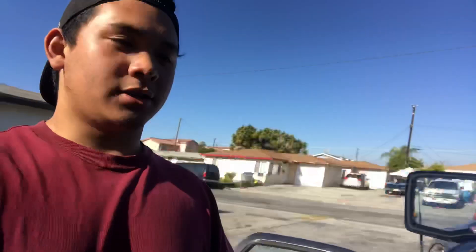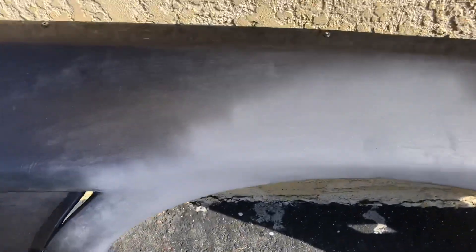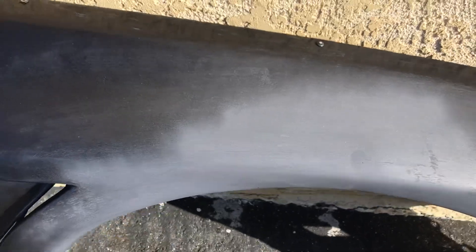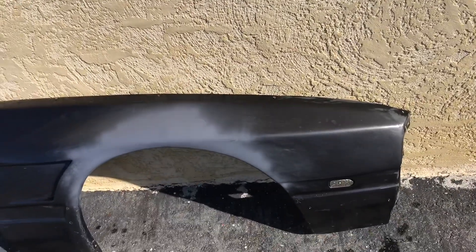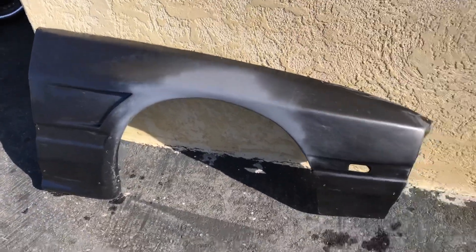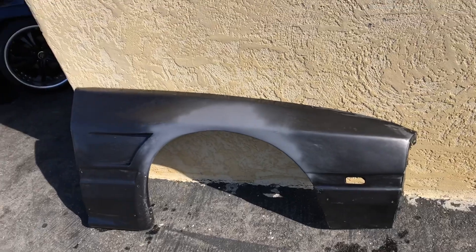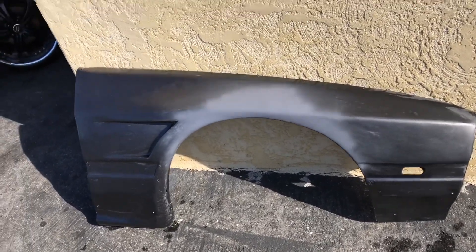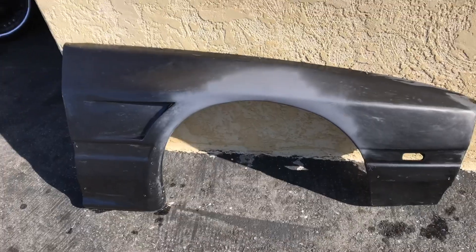The car is running, everything's good, so I let it charge. I threw some primer on the fender already and got it sanded down. I went through it in some spots back to the raw material, but the rest still has the base coat sealer underneath it — so there's no point putting primer there. I just primed up the spots that were back to raw material, sanded that down smooth, and now we're gonna hit it with the paint and hopefully get it done today.